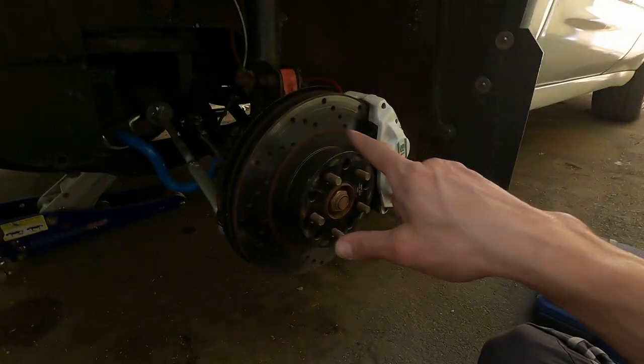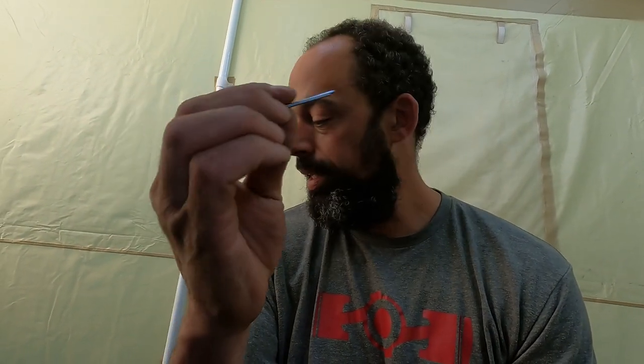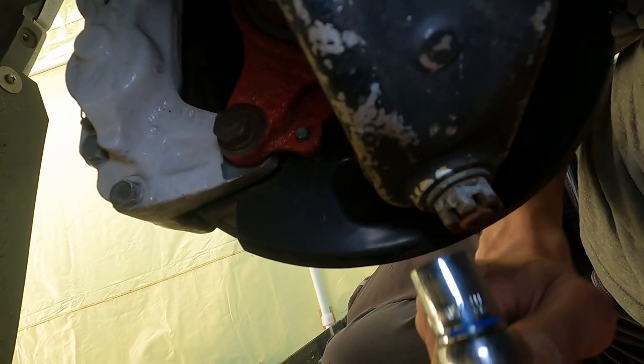And I was like, I'm very aware when I drive, and I knew it was coming from the front driver side somewhere. So I checked all the bolts. I checked every single bolt and then finally at the end, that one right there — the castle nut on the lower control arm to the hub — there was no cotter pin and the castle nut was loose. So there was some play in that thing. That could have been dangerous if that came apart. Here's the cotter pin. That's all I was really missing. I think it was 78 cents, maybe 90 cents, less than a dollar.